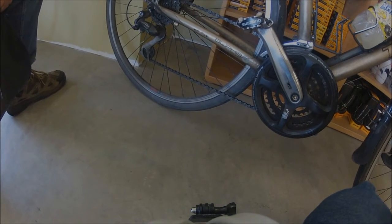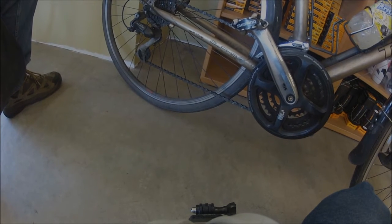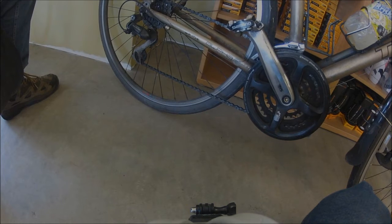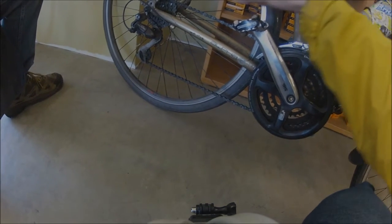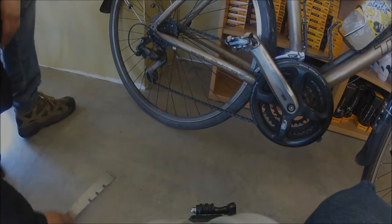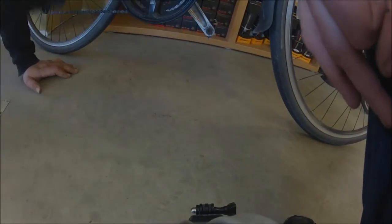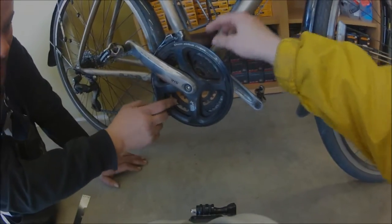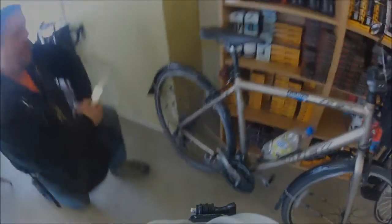So what you're saying is I'm okay for now? I think you're okay to make it 26 miles home. I would take it easy, but you're gonna need to replace this — the chain and this sprocket. We might even end up getting into the metal ring too, but it doesn't look horrible. Neither does the big ring, so hopefully we're okay on the front. But this definitely needs to be replaced. I'm getting my income tax soon, so I can use that to fix it up.